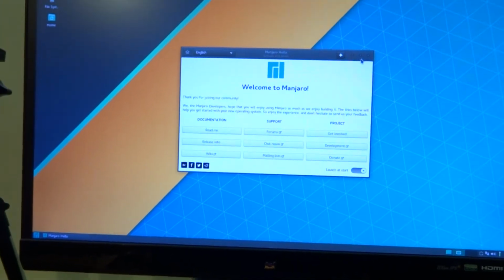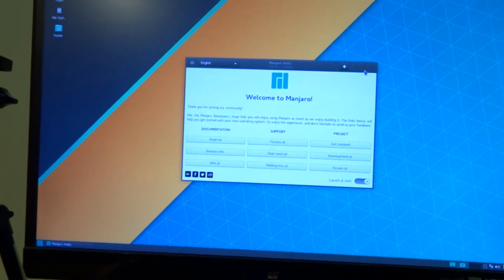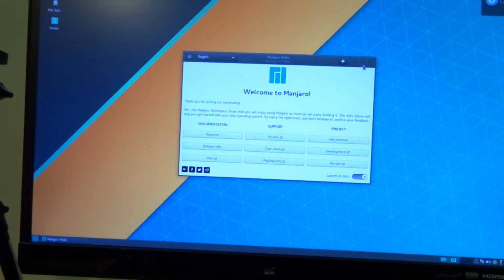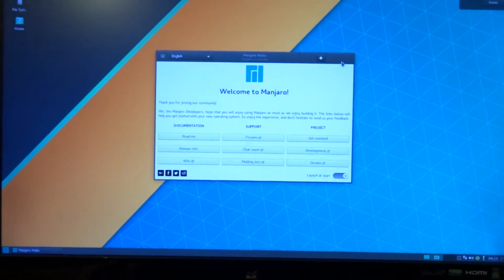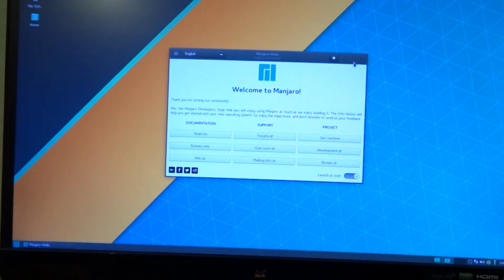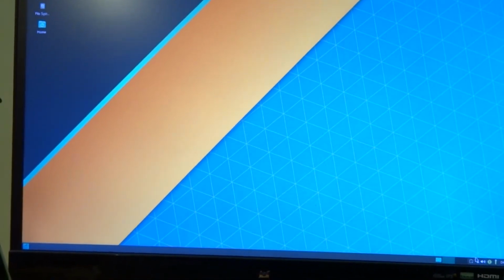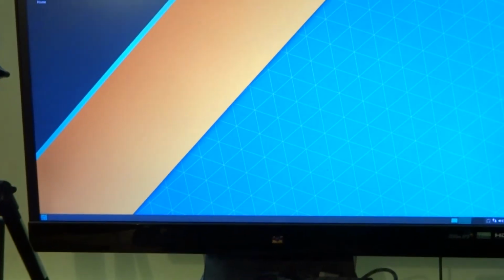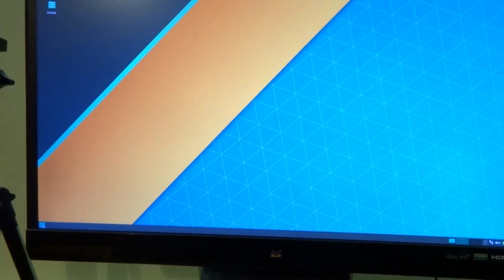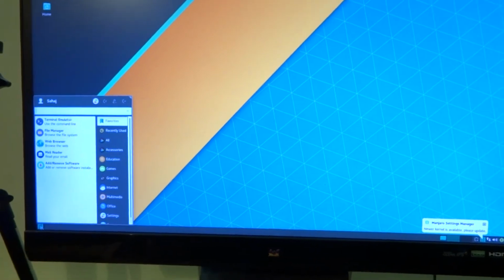So if I install something that is on the NAS drive, if I run the exe directly from the NAS drive on my system, and while the exe is installing, suppose it's like 20 or even 40 gig, it will still have issues, and the installation will fail in between, which is not an issue with a Raspberry Pi, which is extremely stable in this manner and can have 100% throughput. Even the Jaguar board had 100% throughput, but it's only when you are streaming something that is a continuous file, something like directly using an MP4 file. It has to be a single continuous file, and that is it.